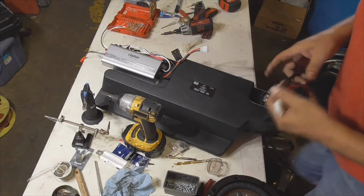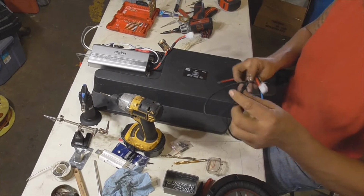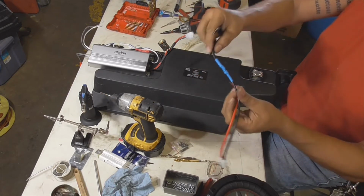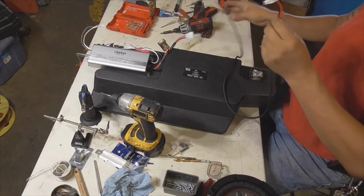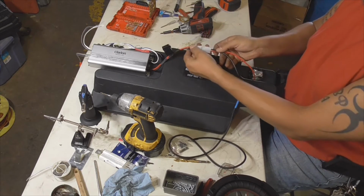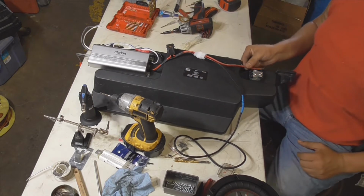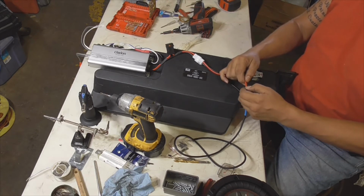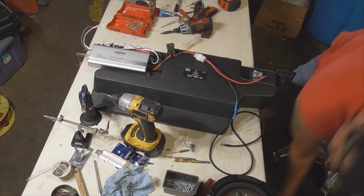Again, I'll give you guys a quick snapshot of where I'm going to attach this. This is going to be attached to the jack brace, to one of the mounting bolts on the jack brace. I'll show you here in a little bit. But this connection here is soldered. This came with my amp kit. All right, this is all that came with the amp itself. This came with the amp mounting kit. All right, so we're going to go in here like so. And then right here into our power distribution block. Piece of cake. Then just tinned. This thing's got a terminal, so don't break that cover.